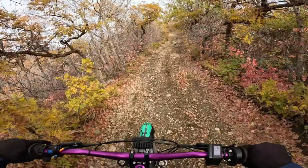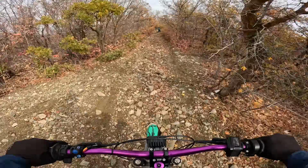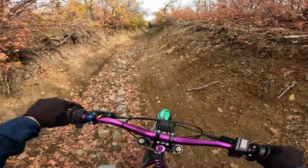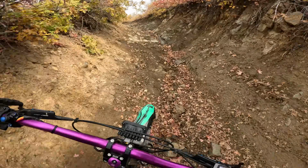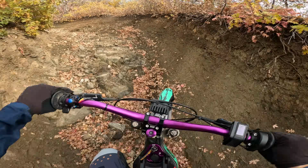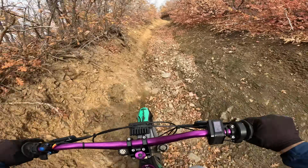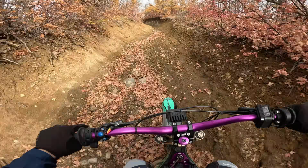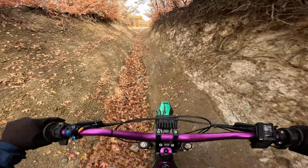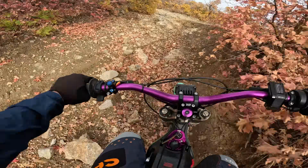Because I've seen a lot of people going around riding springs that are just way too stiff for the kind of riding or the type of rider they are. You know, how hard you push a bike. I'm not calling people out for being not as aggressive or not as good riders. That's not my intent at all. I'm just saying, if you don't ride or push as hard and you ride stuff like we're riding today, you shouldn't be on a 50 or 100 pound stiffer spring just because someone told you to.